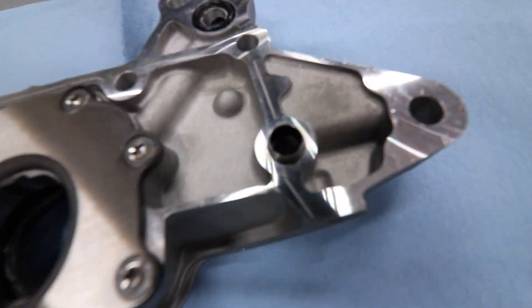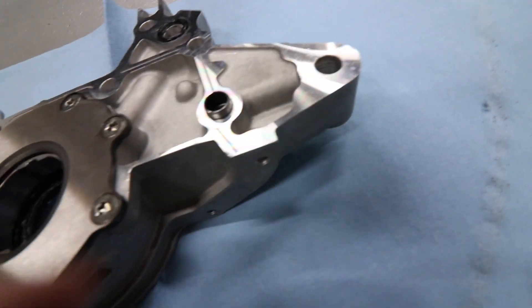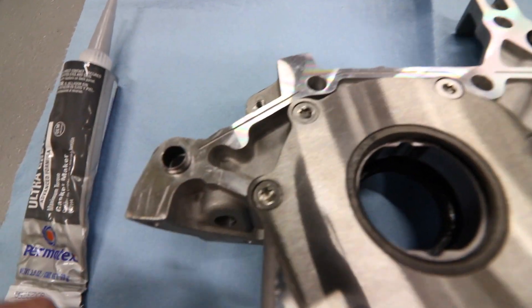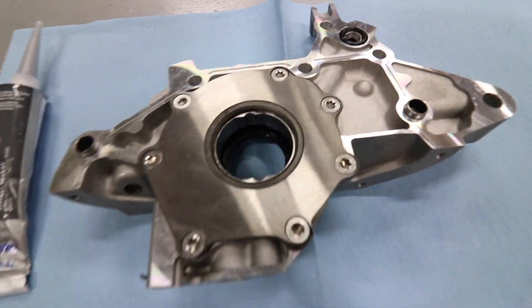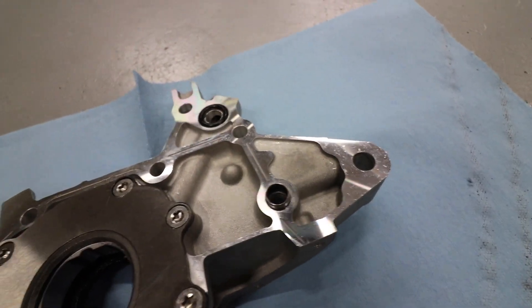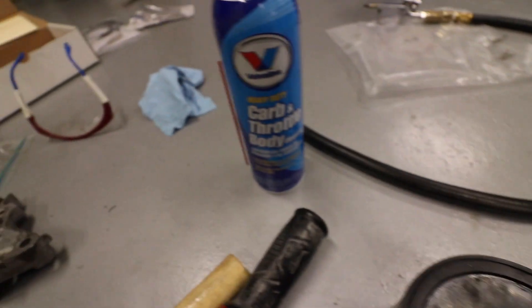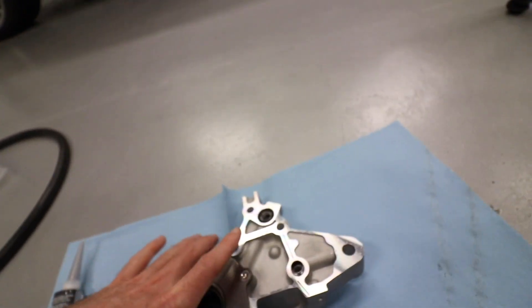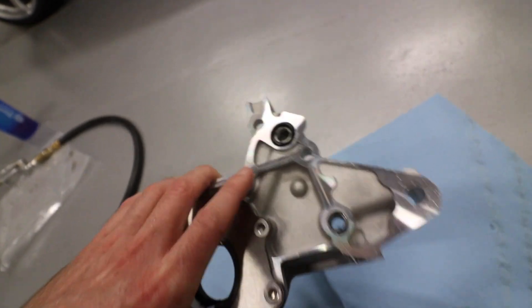It's actually a different day — same shirt, different day. Some stuff came up and I had to cut the video short, but let's continue where we left off. Now we're gonna take the Permatex Ultra Gray and put a bead along all of the mating surfaces — you can see these little crevices — run a bead along those and around all the holes. Also, the oil pump comes with a little bit of grease on the surface from packaging, so clean that out with carb or throttle body cleaner, and put a little bit of lube on the crank seal and the O-ring.